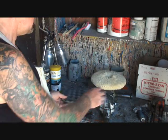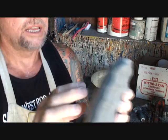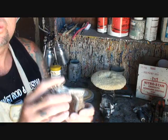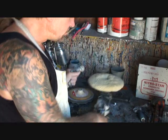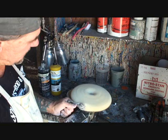Once we are done with the wool pad, we will go ahead and install the waffle face foam pad. This is a hook-it pad that requires a special pad backing that goes onto your buffer. We also have a special tool called a spur — this is to clean our wool pad as we go. As you learn to buff, you'll see that wax will build up on your buffer. What you want to do is turn your buffer on and take your spur to clean your pad off.